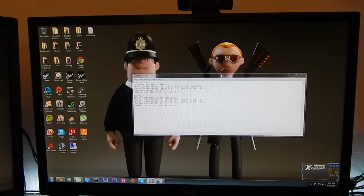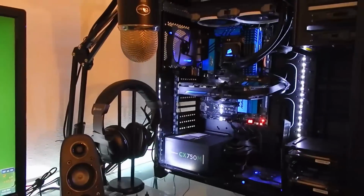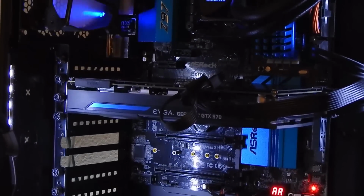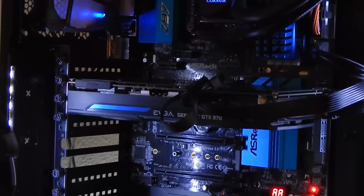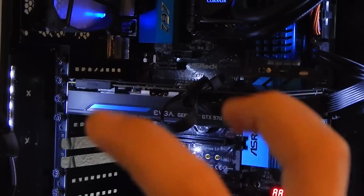I did not go over the 3.5 gig RAM issue because you only experience that issue if you're running very, very high textures, in which case you'll go above the 3.5 gigs of usage. Right now I'm not worried about that at all because in most games you'll only hit about 2.5 or so. But we do have 4 gigs of RAM available, 3.5 available technically, and then the other 0.5 available just at a slower speed, and that's kind of the part that's quote-unquote unaccessed.